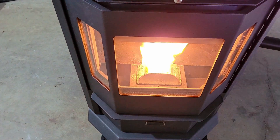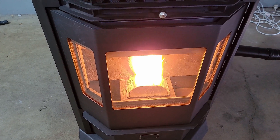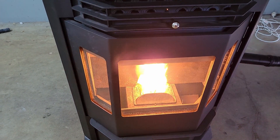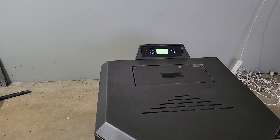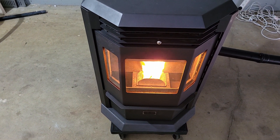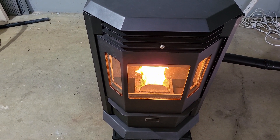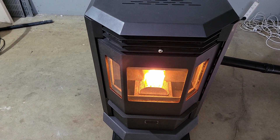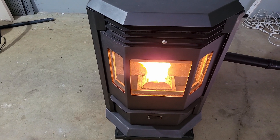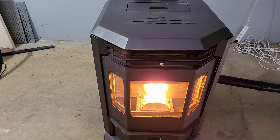So you're looking at about 300 watts roughly for five or so minutes, and then once it kicks on and it's going, the fans switch on and it's pulling about 50 watts — very little power consumption. It's really only the first five minutes at 300 watts — that'd be per hour — so at the most it's 10 minutes of that. Then the fans are just doing about 50 watts per hour, really light on power consumption. You could even run these off batteries if you knew what you were doing.